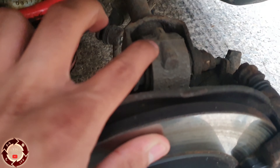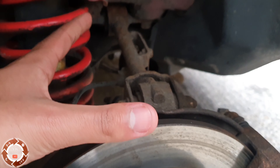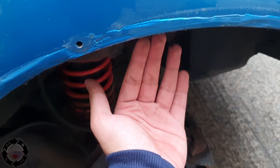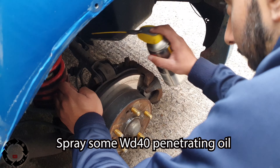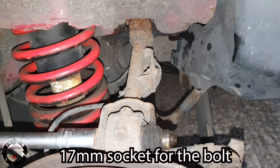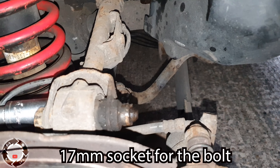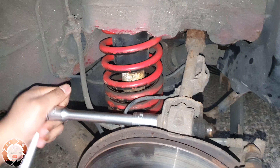Loosening the Honda Type R's wheels. Welcome back to YK Recreation. Today is the ute on the Honda Type R — we're putting camber arms in. This bar here is what we're going to swap out; it connects there and there, which will shorten or lengthen the distance so the wheel can fit nicely inside the arch. Let's get cracking.